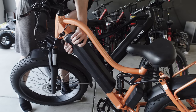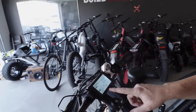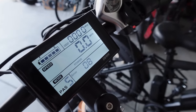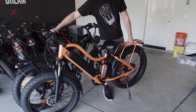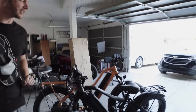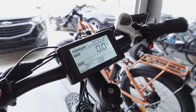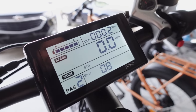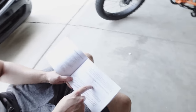The batteries are so hard to get in. We finally got these set up but when I turned it on, the first thing I noticed is it says Error 08. Let's just see if the motor even works. Nope. It's not looking too hot for Be Cool e-bikes right now. Error 8 - throttle problem.